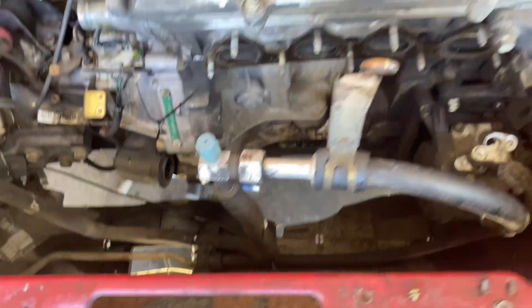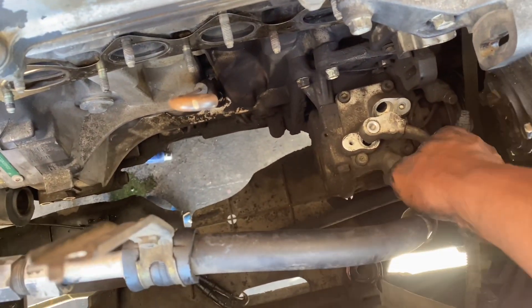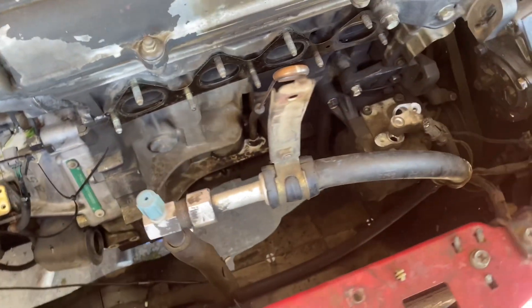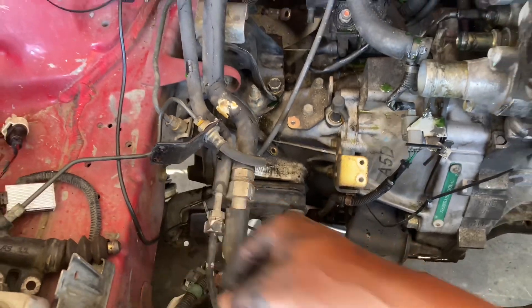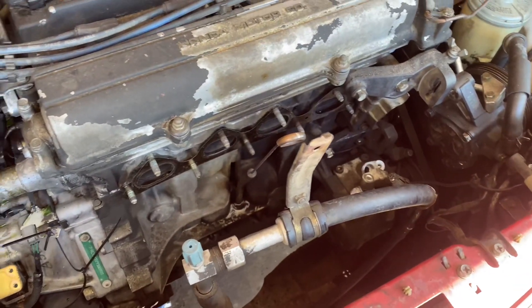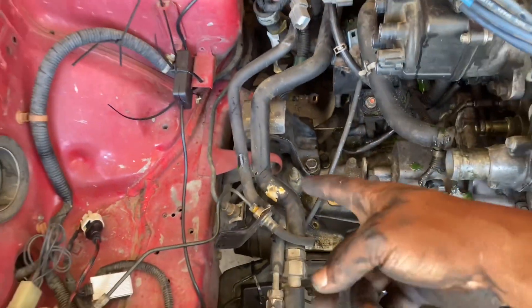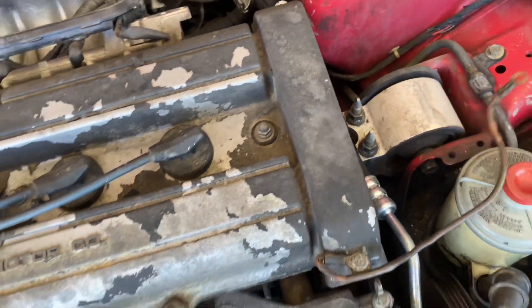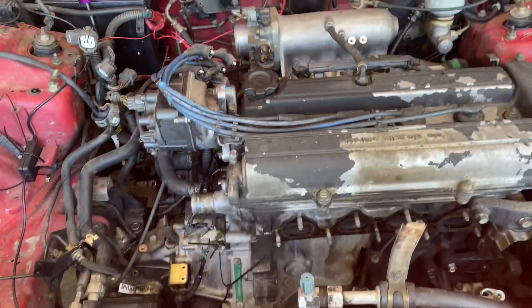We're back now — I got the radiator drained and taken out, half shaft axles and shift linkage all out. Next I'm going to take off this AC pump, which is four 12s — two at the top, two at the bottom — then get to the AC bracket which is the vibration mount. On the other side you've got three 17s and two 14s. Pretty much getting to the motor mounts: the rear mount is a 17, then three 17s over here and three 14s, and the motor should be able to drop after that.